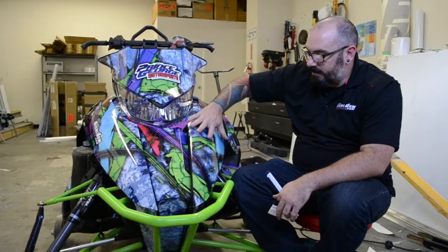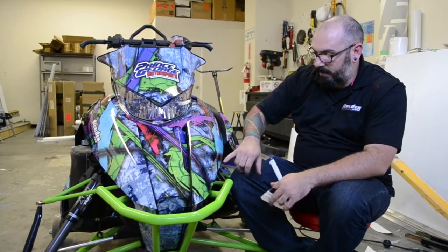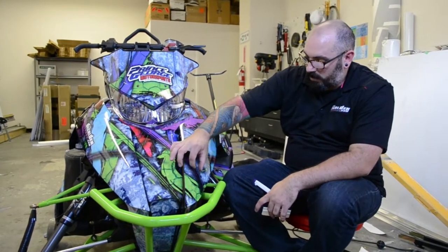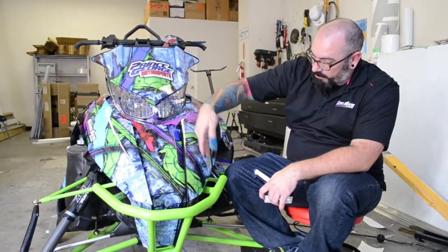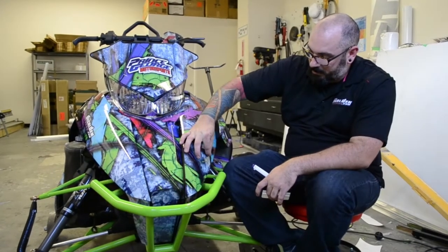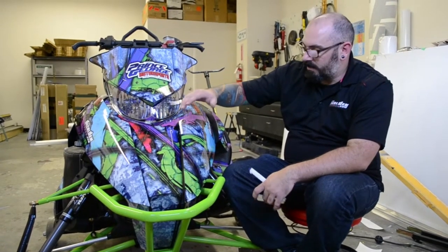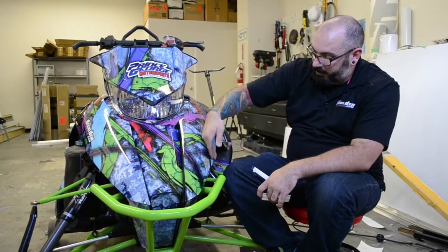So as you guys can see, basically as long as you manage those fingers early, don't wait till they get down to here and they've actually started to crease. You gotta make sure you start managing them as soon as they start happening, up in this range, and work them from the end down rather than side to side. Because if you go side to side, you're gonna cause those ripples to come together. They'll create folds.